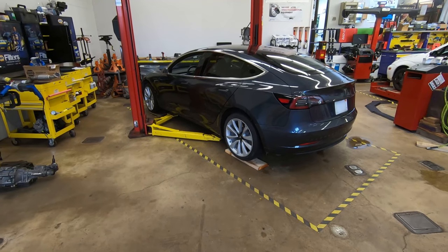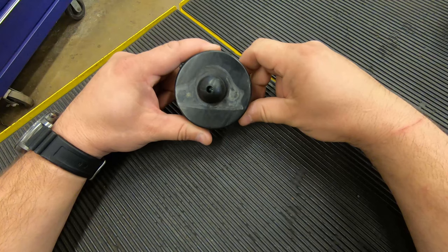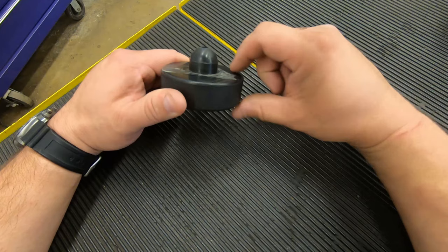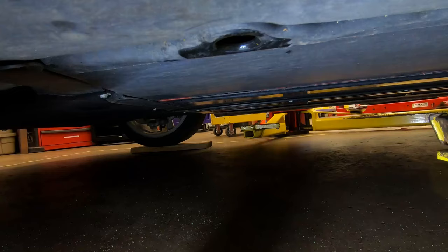In this video we're going to show you how to do your annual brake service on a 2018 Tesla Model 3. Your Tesla is a little bit different than some other cars — you actually need some kind of jack pad. There's no pinch weld on this car like a traditional car, so these jack pads are necessary. I'll put a link in the description. They're a very simple design, basically like a hockey puck with a little nub, and they work on the Model 3, S, and X.